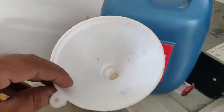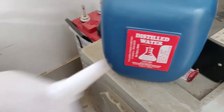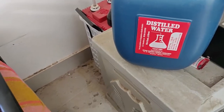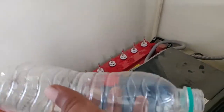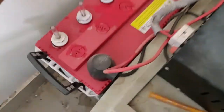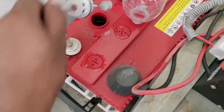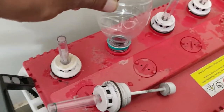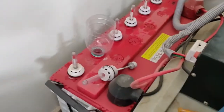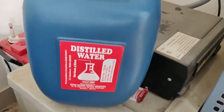The second thing is the items you need. You need a funnel — a clean one. If you don't have a funnel, take a regular water bottle from the shop, cut it in half, and it becomes an easy-use funnel. The mouth fits exactly into the battery cell. It's better than a regular funnel and much easier to use. You'll also need a few liters of water depending on how empty your battery is.